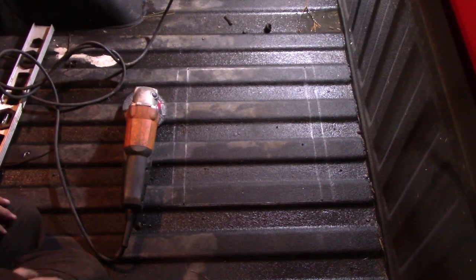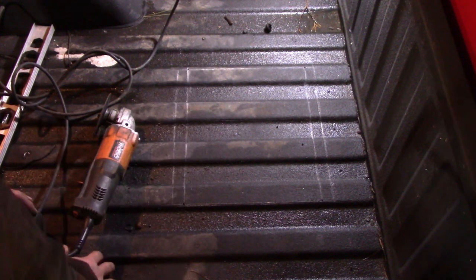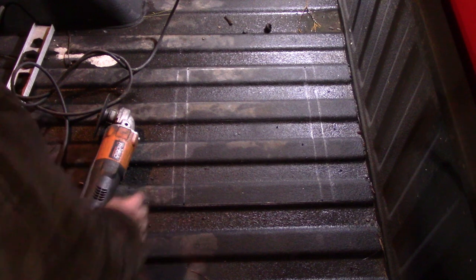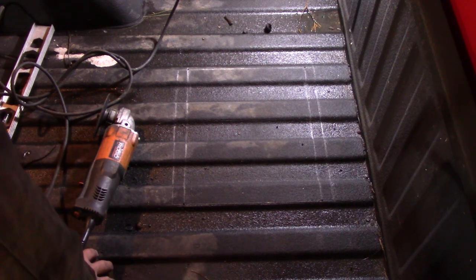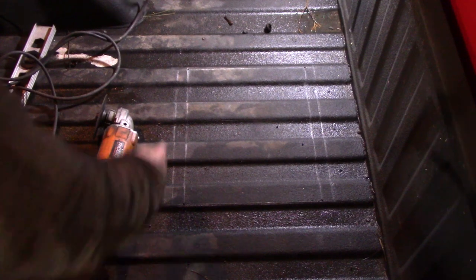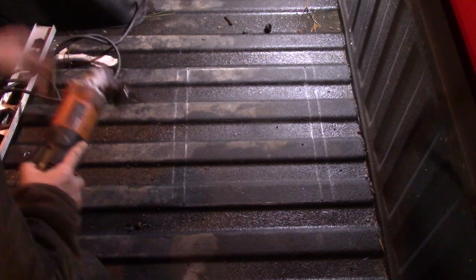I think this is going to be the best bet — using a wheel as opposed to a plasma cutter, because there's a fuel tank under here. Even with a wheel it's going to create some sparks, but this is that Line-X so hopefully not too many sparks. Using a plasma cutter — you can imagine hitting your fuel tank. Let's go to town here and see what happens.